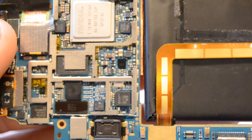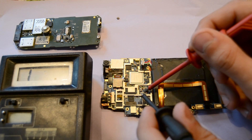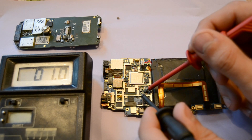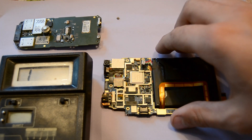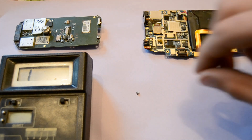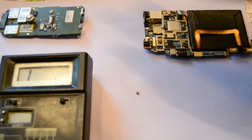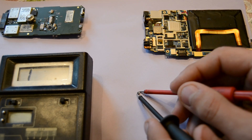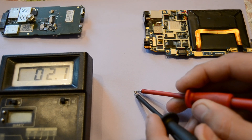Now I want to show you a little way to test your coil. All you need is a multimeter — set it to below 10 ohms, then measure at both ends of the coil and check the resistance. If the resistance is below 1.3 ohms, the coil is mostly shorted. As you can see, this burnt coil had about 0.6 ohms. Now measuring the working coil from the old Sony Ericsson — the resistance should be between 1.3 and 1.6 ohms. Here we get 1.6 to 1.7 ohms, so this coil will work.